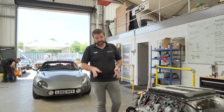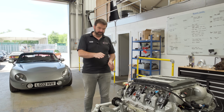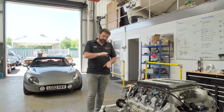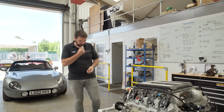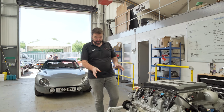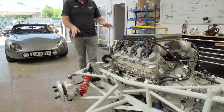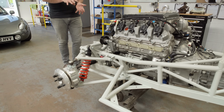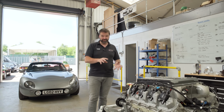And it's the relationship between the centre of gravity. So the centre of gravity is like where the main mass of the weight of the car is, and it's the relationship between the centre of gravity and the height of the roll centre, those 2 points that you're trying to control. The centre of gravity acts like a lever over the roll centre. So as I say, once we'd analysed it, how you do that is by changing the orientation of these pickup points. And we found by changing those, we were able to raise the roll centre height, which then gave us better conditions in turn in and roll, and basically you're trying to reduce the amount of roll.